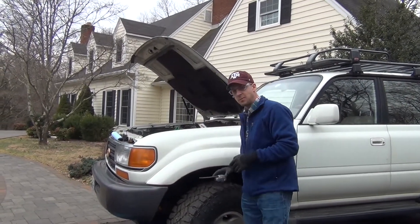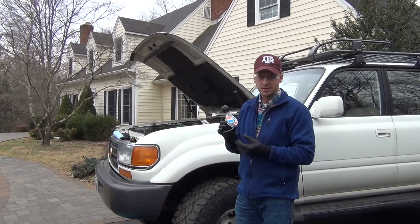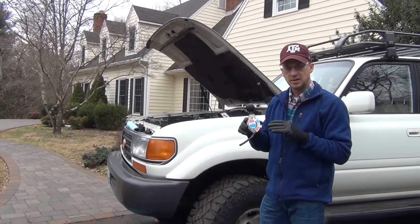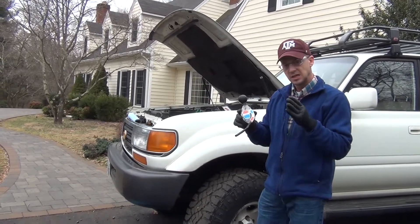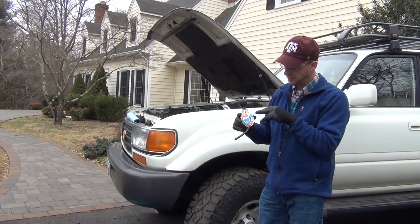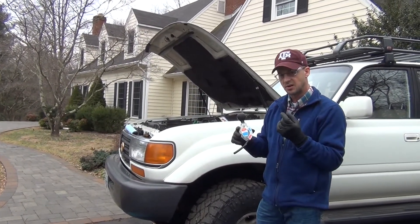But something that a lot of people aren't aware of — my dad used to have one of these and I just didn't know what it was — it's a hydrometer. This is going to check the specific gravity of the solution in each one of the cells, and what's good about that is it can tell by the specific gravity if that cell is holding its charge.